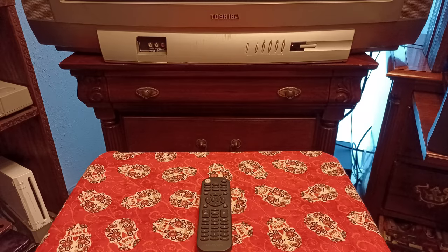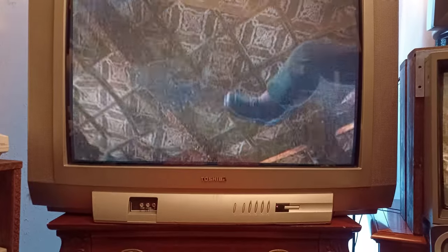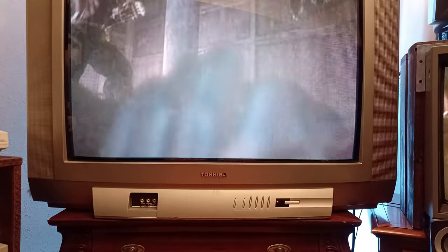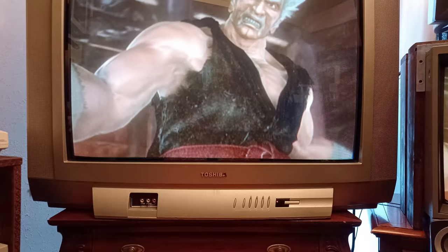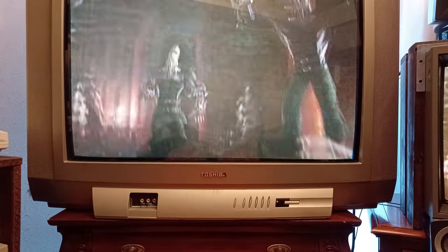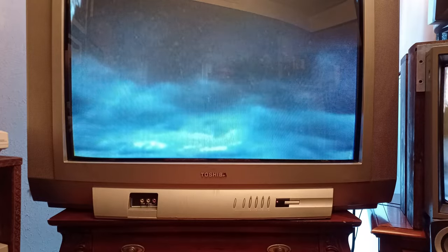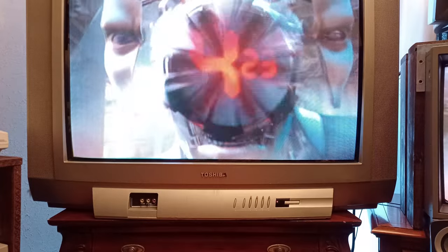For example, right over here I got this big beautiful Toshiba 36A43 — it was in the trash. A dude helped me load it in my car, brought it home, got it cleaned up. But when I went to use it, the buttons on the front didn't want to work. The only button that works is the power button, and those other buttons along the bottom — none of them work. I need to open this thing up and clean them with some contact cleaner, maybe some alcohol, because it was rained on and there's all kinds of dirt in there.